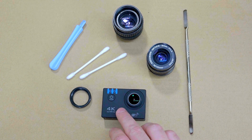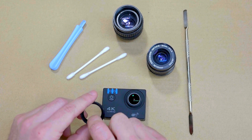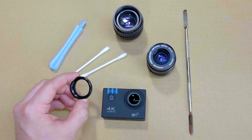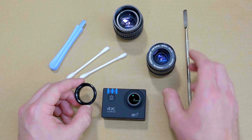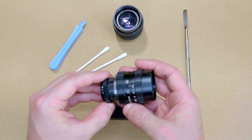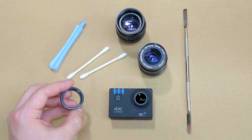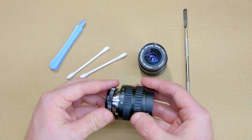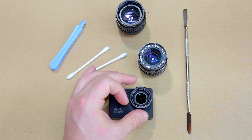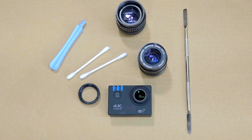At that point, I'll be replacing it, and I've got to figure out some way to mount this inside. This little piece of camera equipment is a C-mount extension tube. This would be used with a regular native C-mount camera to move the lens further away from the sensor. Doing that turns the lens into more of a macro lens, but in this case, I'm not going to be using this for a macro function — it's just a convenient mount that has the proper size threads to attach these lenses. So I'll be using this as my lens mount in place of the stock lens on this camera. And with that, let's begin.